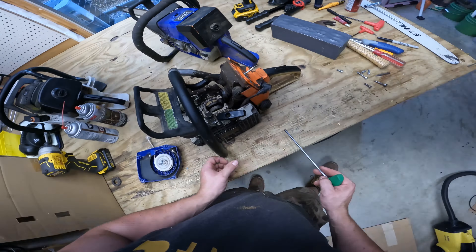One thing I might do is buy a case splitter. I think this FarmerTech case has a little bit of an air leak when the saw is hot, because it doesn't really run as good when it's good and hot as it does when the saw isn't as hot. I'm not a chainsaw mechanic expert, so that's just a theory. It seems I got the right screws in the right spots because none of them bottomed out before they were tight.